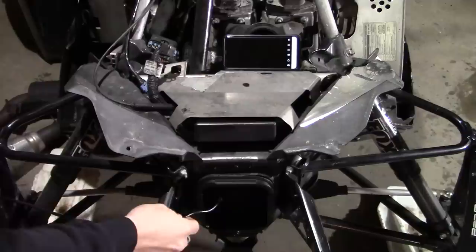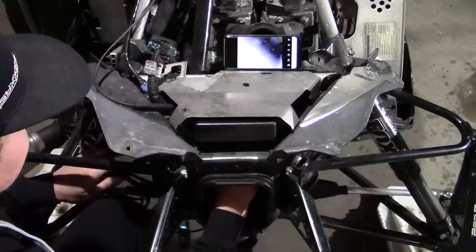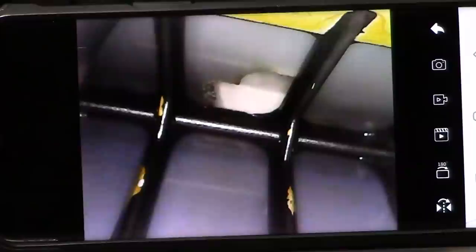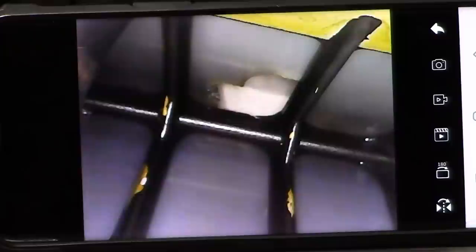The mag side you can actually see almost right into, and then the PTO side you definitely need the scope for. So let's have a brief look in here. I'm starting to see the petals of the reed valve there. What we want to do is just look at them all individually because usually it's right on the end of the flap. This one's looking good - not really seeing anything wrong on that one. There's a good shot of the reed. Holy smokes - you can see that one reed valve is completely smoked. It's got a hole right through it. There's our reed with the big hole in it - not totally uncommon. So we do have to do reeds today.